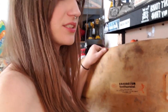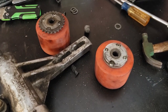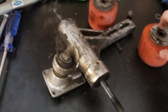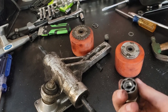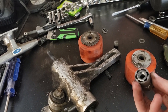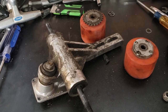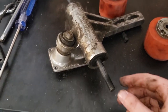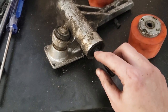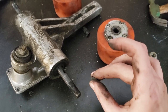It just took a little gentle prying but we got it done. What I found that I thought was really cool is you can still see the original finish — I'm going to try my best to match that finish as much as possible. I got both of the rear wheels off. One side was super stripped so I had to use extractor sockets to get them out. I just wanted to say, if you have one of these and are using this video as a guide, be very careful when you take the rear wheels off. There's a keyway right here — make sure not to lose this very tiny keyway because you're going to need that.